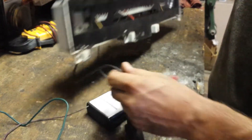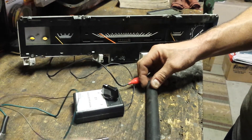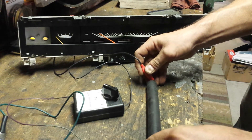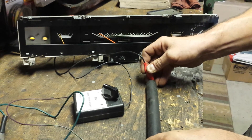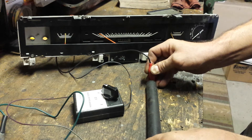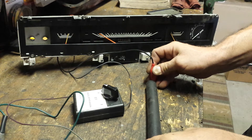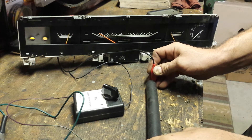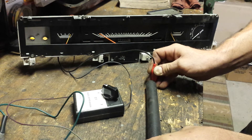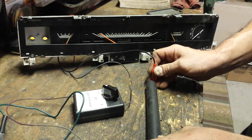The power lead wire goes to the positive side of the battery and the negative lead from the tester goes to the negative side. We've got our tester set on full. Get them connected and you should start seeing some movement — there goes the gauge. At least we know the gauge is working. Accuracy in the car is going to depend on how tight your connections are and what kind of condition your wires are in. A lot of things can cause you to see less voltage up at the cluster than what the battery is putting out — it's all resistance, it all adds up, and it will make your gauge act funny. I've tested this one a couple times and it goes right up to full, which on 6 volts means the gauge is probably not in the best shape.